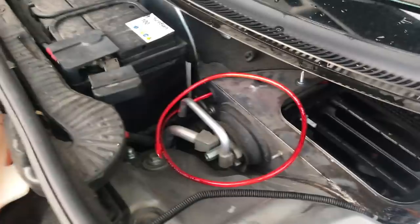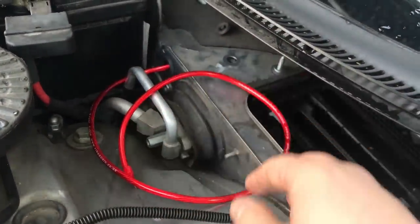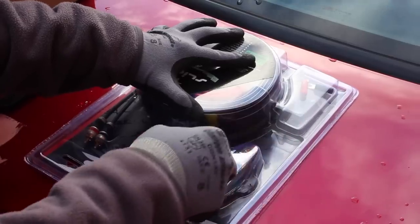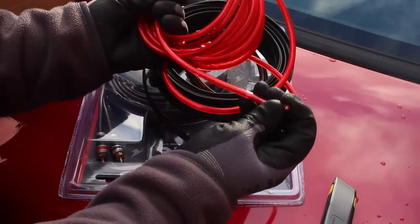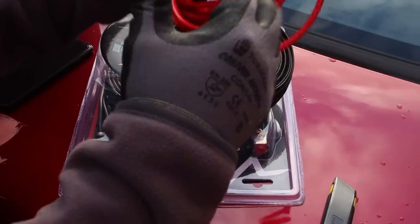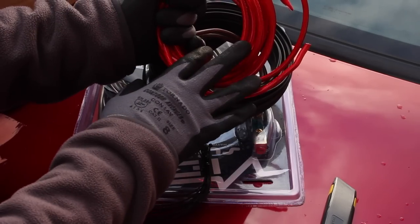The major point I'd like to stress is to make sure the cabling is adequate in both length and thickness. The more powerful the amp, the thicker the power cables have to be to support it — I've left a link in the description to help you determine exactly what thickness you need. For this install I'm using the Vibe Slick 8 gauge wiring kit. If wires are too thin they can heat up and electrical fires could possibly occur. I personally like these kits from Vibe Audio since they contain everything you need: live power cable, earth, fuse — which is very important, never install a sub without a fuse — speaker cables, and remote and RCA cables to connect to your head unit.